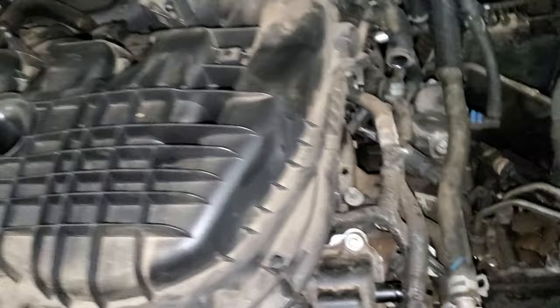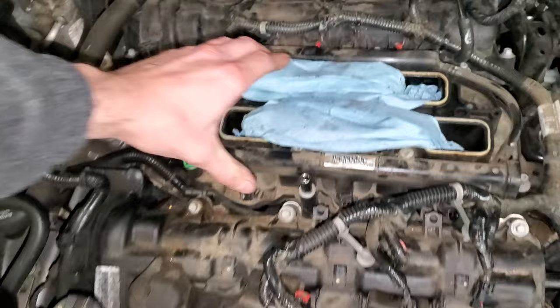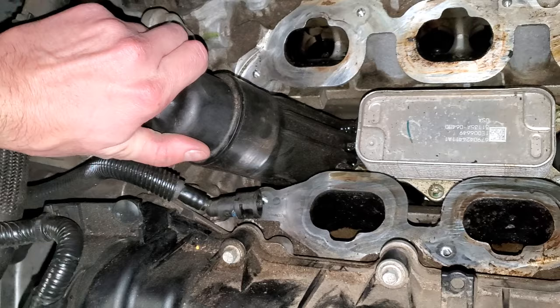As far as what's needed to get this fixed, you have to get a whole new oil cooler assembly. This has got coolant and oil going through it. You have to remove both the upper and the lower intake manifold, and that will expose the oil cooler. What happens on a lot of these is it'll crack down there somewhere, mostly from people over-torquing the oil filter.